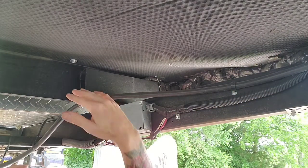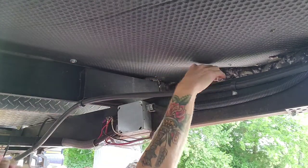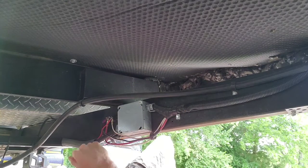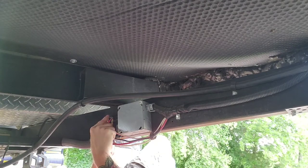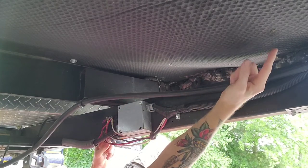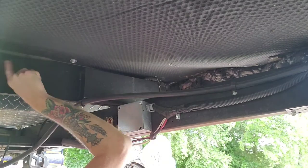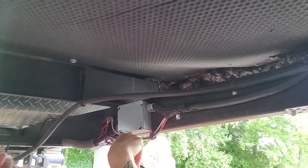All you're going to do is remove your battery cable off of this bus bar and run it up into your underbelly. To do that, pull down the front corner of your underbelly — there are some screws to remove and some foam sealing this corner that you'll need to cut away. Then replace it with Great Stuff spray foam when you're finished. It's as simple as taking the connection from this point, running it up into your underbelly, and through the hole you have access to from inside your camper.